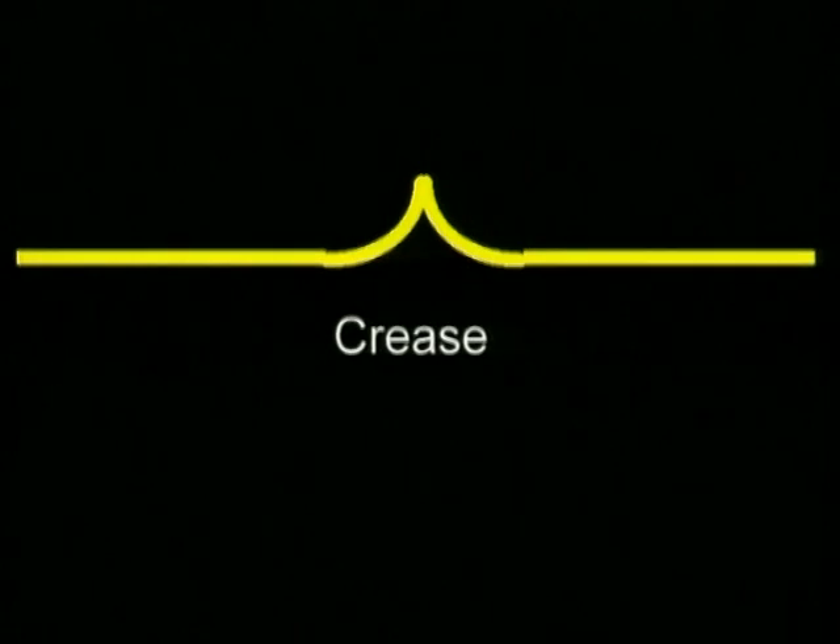Creases can go in or out depending on what caused them. As you can see in cross section, the metal goes to a point and no matter how much it has been worked, it has been stretched beyond its ability to be flattened again — you will not be able to get rid of it entirely. With normal dents you are simply working the metal back into its usual position; the metal has not been stretched excessively. Creases can be caused by using the tips without caution and by applying too much pressure. Whilst working on vehicles you will probably come across micro highs and micro lows — smaller versions of highs and lows — often created during this process. Removing them is just part of the job.